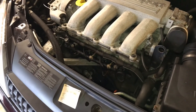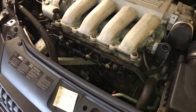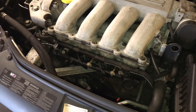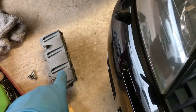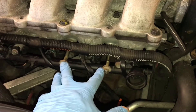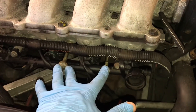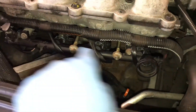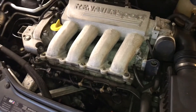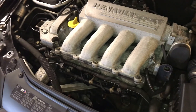That's it all back on — it went back on about ten times easier than getting it all off. What I've got left to do is put the metal shroud back on and the engine cover, but before I do that I want to check for any leaks. I'm not going to put the metal shroud on just yet — I want to check all the injectors, make sure everything's running smooth and clean, and most importantly that the fault light's gone.